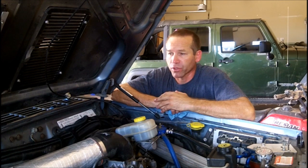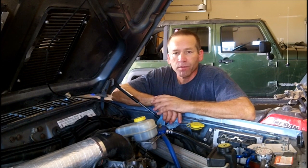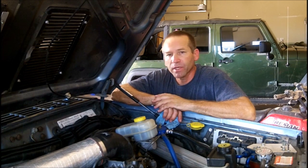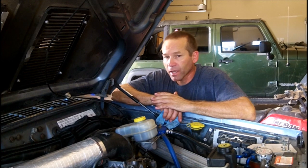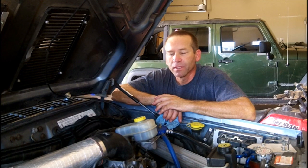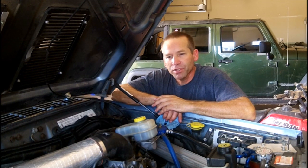Of course, at normal operating temperature. And to do that, by the way, do it just driving around town where you're not getting it into overdrive. Because once you get it into overdrive, your transmission will actually start to cool back down because your torque converter is locked and there's no slip. I can get my transmission — like you saw there — up to 194, and that was just driving up and down the surface streets, never got it into overdrive. As soon as you get into overdrive, you can actually watch the temperature go down. All right, well, thanks for watching. I hope that was helpful for you. Please subscribe. We'll see you next time.